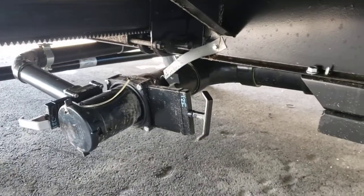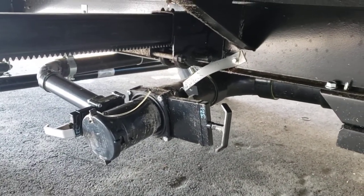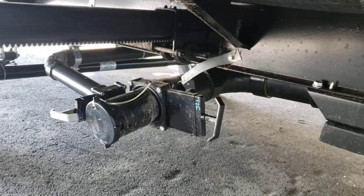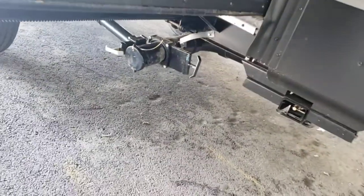Back here at your dump area, always make sure the valves are closed before you take that cap off. When you hook your hose up, do your black tank first — get it all the way empty — then do your gray tank. That way, when you pick up your hose to move it into your bumper, you don't have a hose dripping with black tank water because you flushed it out with your gray tank water.